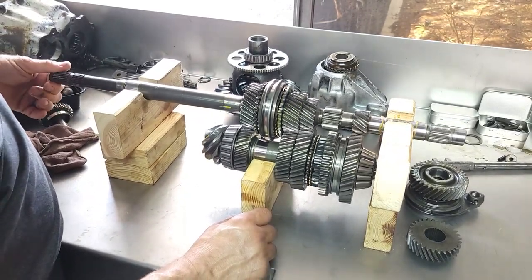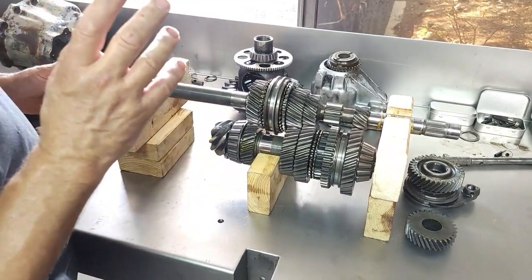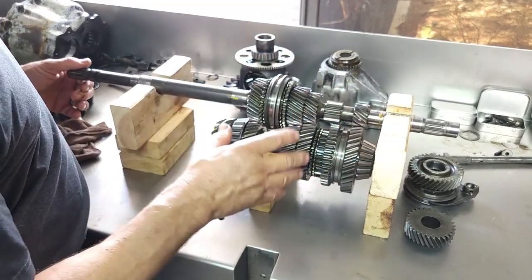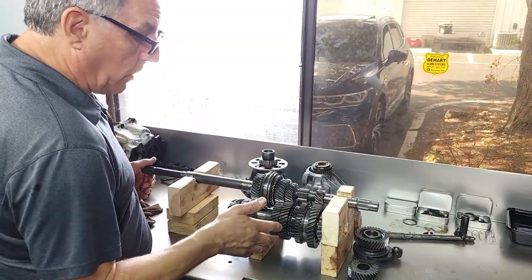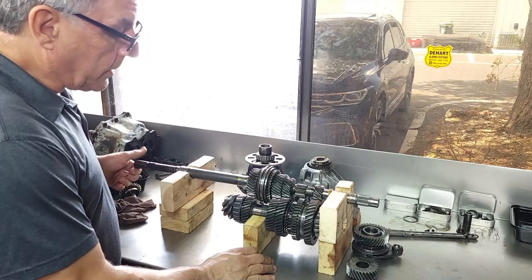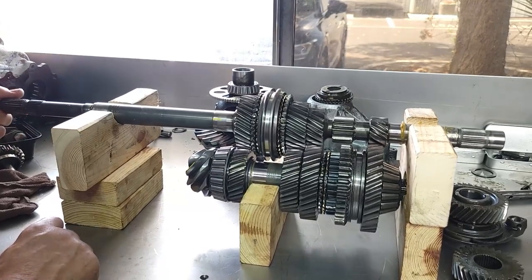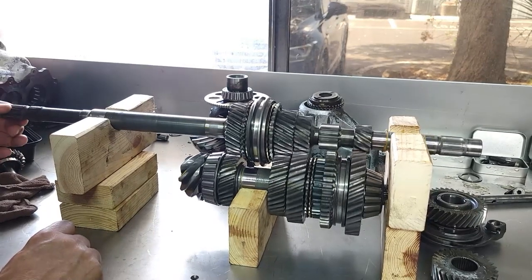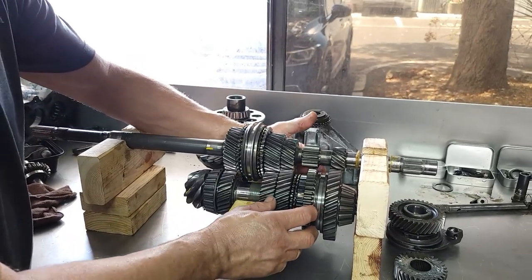Pretty simple really when you look at it. It looks complicated because of the mechanics of it, the engineering of it. Whoever designed this had to design the gears, how they mesh, how they engage, design a case that makes it all work, and a shifter that makes it all shift — just amazing engineering. There's first gear. You can see how many times I'm rotating the shaft just to make this go — first gear is relatively low. We're revving the engine like crazy but barely going anywhere, and that's great for torque. We're using the engine's torque to start moving the car.